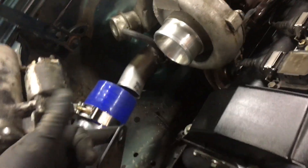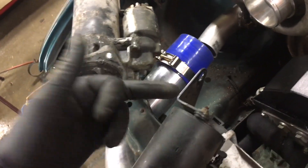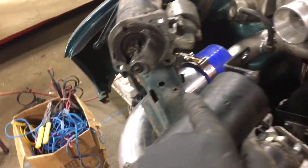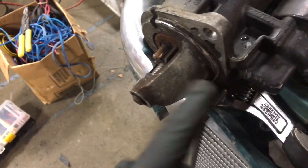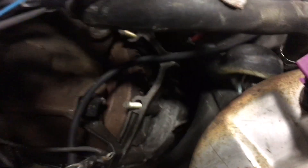There is actually a provision on the engine block for this hole, but it kind of gets in the way of putting the starter in with all the engine harness, so I'm going to take this bracket off — which is just there for additional support. Then I'm also going to either remove or cut off this pin, because there is one on the transmission and that ain't going to work. I'll have to pull it out, get it in the vise, smack on it a couple times, hopefully that comes out. Then time to slap it right on in.